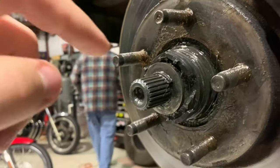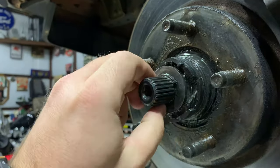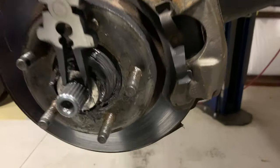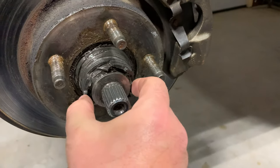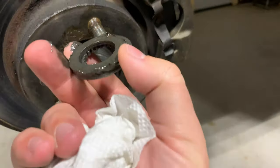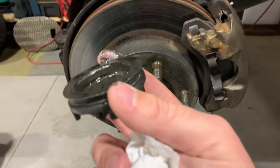Here is your little lock that goes in the end — this little ring. Under that is your washer and it is splined on there, and then there's another piece behind that. We'll show you each piece as it comes off. First thing I do is take this clip off. Let's get something to go around both sides — there it is. It went flying like they said it probably would. Next, take off this washer — it's splined and you're going to need that later. This little cam washer came with it. Now we'll slide the cam out of here — there's the cam. That's the automatic one and we won't need this.